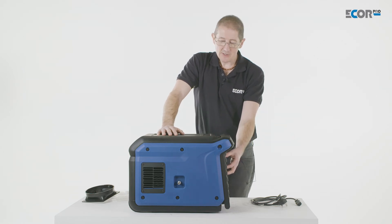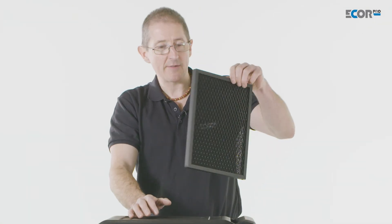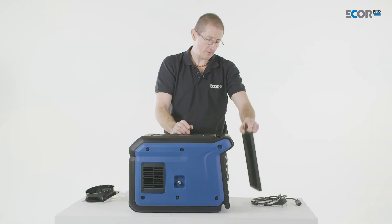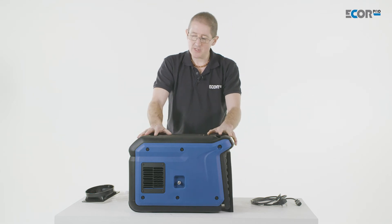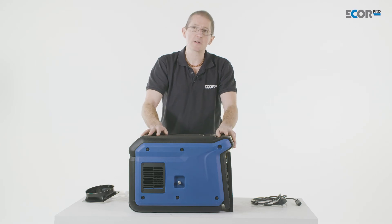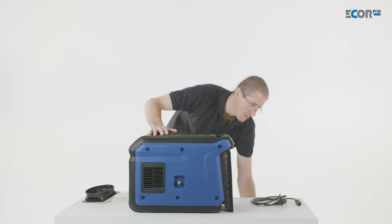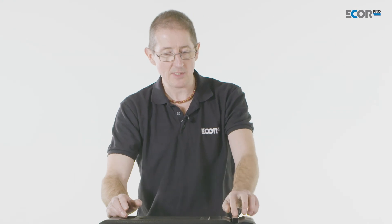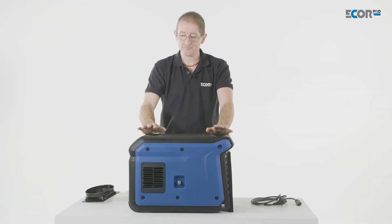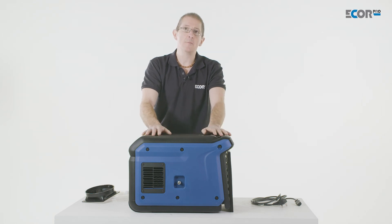Air coming into this machine is filtered. The air naturally carries particulates, so this machine incorporates a filter which traps lint or fluff. These machines aren't designed to work in harsh environments like building sites and construction sites, but people will abuse them. To reduce the impact that may have on the machine, it can be fitted with a HEPA filter that simply slides in and locks. The HEPA filter reduces the airflow through the machine, but it protects the machine, so if it has to be used, it can be.